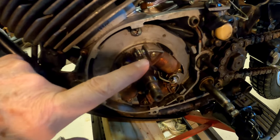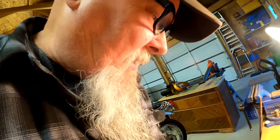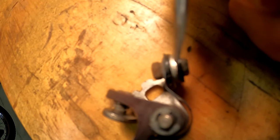There's a little wire that hooks up right here at the top of the points, and it's critical to the operation to get the right spark. Here's the old original points, and I have the new points in the bike. My mistake was I had placed the wire in the wrong place — it was in between this insulator, and it should have been on the outside here, because it was actually grounding out right there in the middle, and that's not where it's supposed to be.